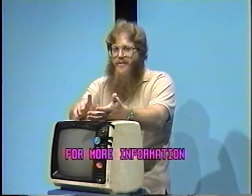And we've also learned that we can keep our equipment clean and in working order with simple maintenance methods. We've also gone over those special do's and don'ts, especially that big one of making sure that the computer is the first thing off and the last thing on if we don't have a switch by which we can turn it all off and on at the same time.